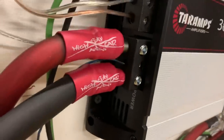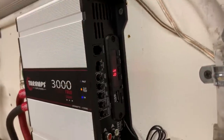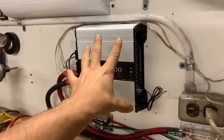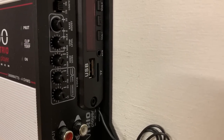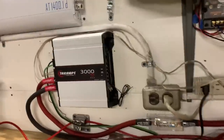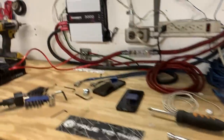Another interesting thing — I actually have the radio off. We're not playing through the radio, we're playing through the Bluetooth. There's a remote wire, but to turn this thing on and off, you hold down the mode button — a little bit different. Another thing to note, and I actually kind of don't really like this: I think this is really meant for mid-bass and highs, not necessarily a subwoofer, even though it does work for one. Since the crossover only goes to 700 hertz, you're going to hear vocals through your sub — it's not just going to play the bass. If you want to use this as a bass-only amp, you would run your RCAs from your head unit, set your head unit to have a low-pass filter, and then you'd be fine.